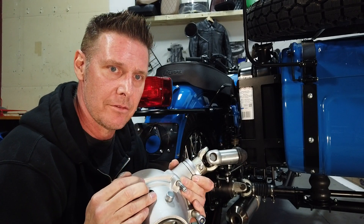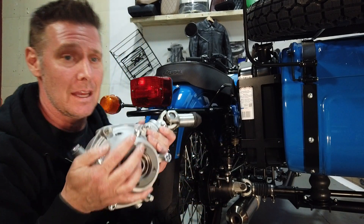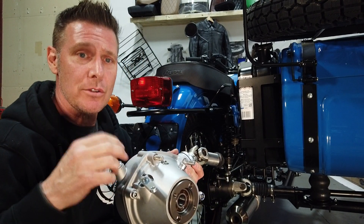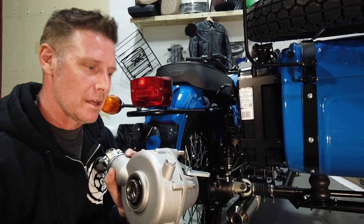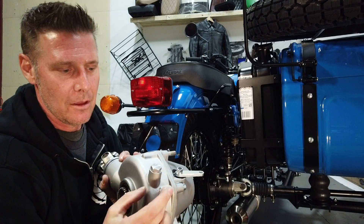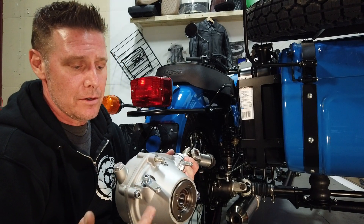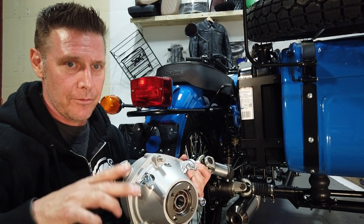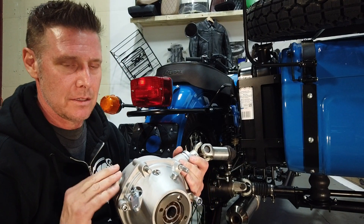You may think you have a bigger problem than you actually do when it's just pushing out oil that it can't contain within the case. In the old days the dipstick was also the breather, but it was in the same general area as the ring and pinion, and it was flinging oil right onto the breather — you'd get this misty donut ring around the area, and it was always a mess. Over the years, through real-world study and testing on how the oil flowed with the ring and pinion, they relocated the breather and made the dipstick solid.